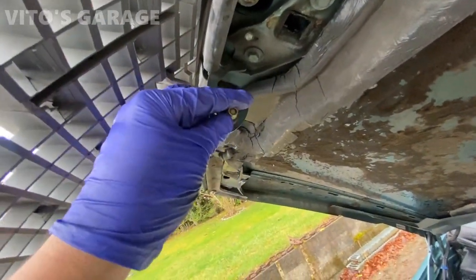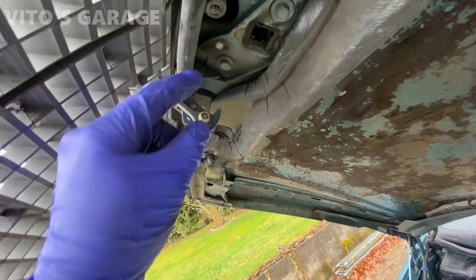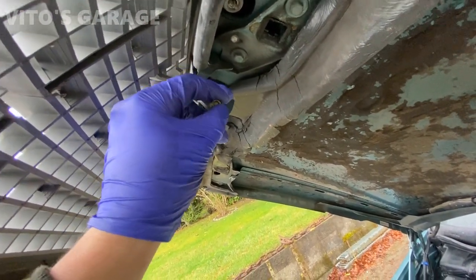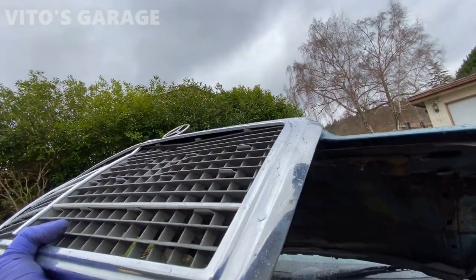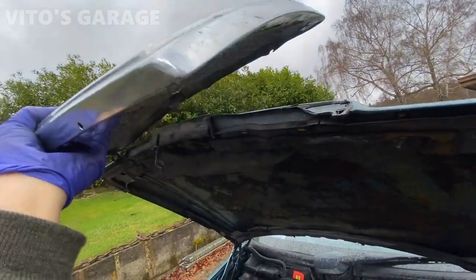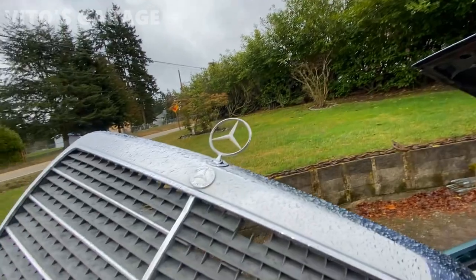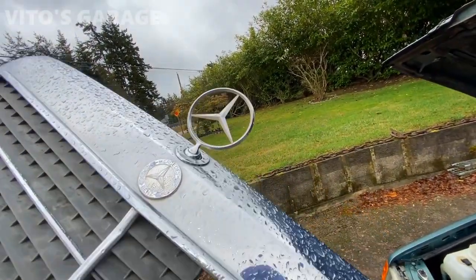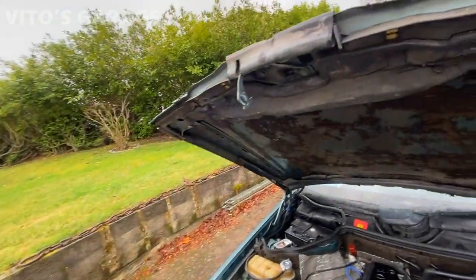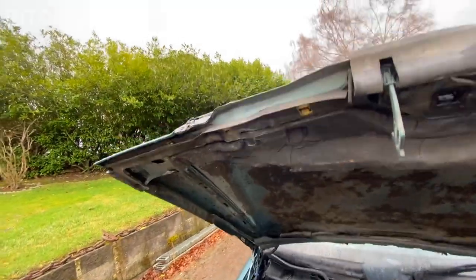First, you're going to take this off — 10 millimeter nut — and then I have to loosen the hood star or the grill star after that. There's a bunch of 8 millimeter bolts that I already took off and we're just going to take this guy out as an assembly. Because on this car, it's kind of a pain to remove the grill star while it's still installed here, so I'm just going to make it easier on us.